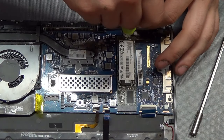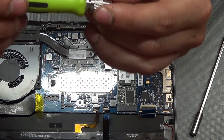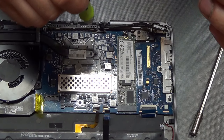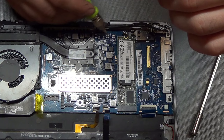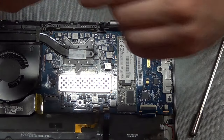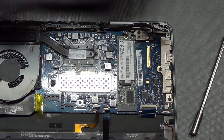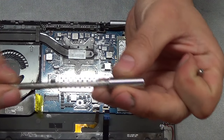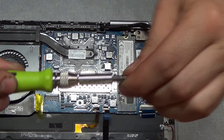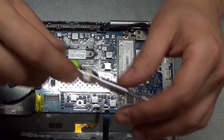The hard drive — just one little screw. See what happened — this is what I wanted to tell you. You secure the bit in the screwdriver, apply some force to it, and the bit just slides in. When you are doing a screw and the bit slides down, the screwdriver can actually hit one of these little tiny transistors or components and knock it loose. You will never find which one is loose because they're not going to come out completely — they'll just crack a joint and stay in place without making contact. So what you want to do is use the extension that comes with the screwdriver set. Just slide it in the screwdriver, and then no matter how much force you apply, the bit will not go into the screwdriver, so you don't run the risk of the screwdriver slipping and hitting something.